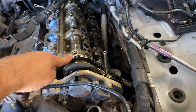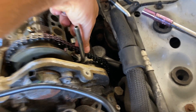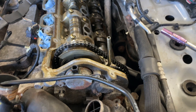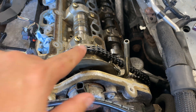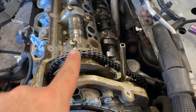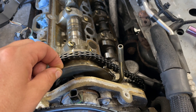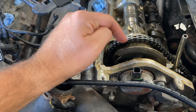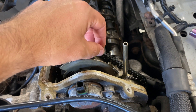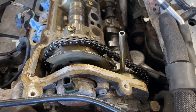I wanted to post this because when I was dealing with this the other day it was very tight, but now it's very loose and it's coming off the teeth down there. I have a 24 millimeter on the crank and I'm turning it clockwise. What's happening is these adjusters turn, it gets tight then loose, then these pop or snap and bring up the tension again. It's making me feel like these tensioners are bad — it's spring loaded and when I go to turn it again it'll just pop. Something's either not catching right or it's all gunked up.